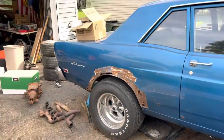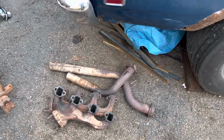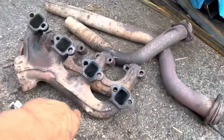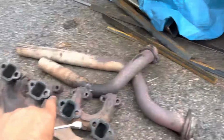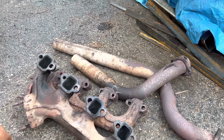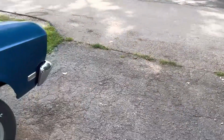So I've been kind of bouncing back and forth between the front and the back of this car. I also started looking at the headers. This is the stock set of headers that I just pulled out of the truck. When I did the tube headers on there, I think what I'm going to do, just because I still have the cutoff sections that I took off, is try and get these bolted up and see if that will remotely work. If this comes close, then I'm going to run these headers with these down pipes, and then I'm going to do some of that cheap flexi AutoZone whatever crap, just steel flexi pipe right into the mufflers. And that should help me with breaking this in without having to do a full exhaust on this setup.